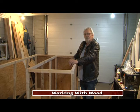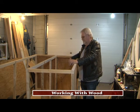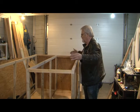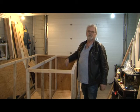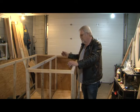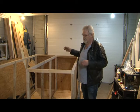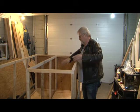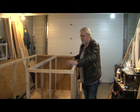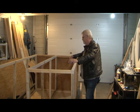If the floor ever rots, which I don't think it ever will, but if it does, you just take the bolts out and pull the cart off of the trailer. The thing that's going to rot is that piece of 3/8. So you take this off the trailer, take the rotten piece of 3/8 out, put a new piece in, put this back on the trailer, and bolt it down. You're brand new for another 10, 15 years. So that's the way we did that.